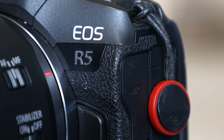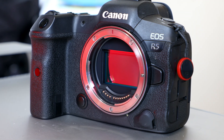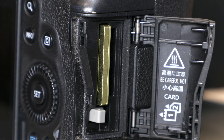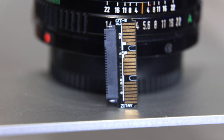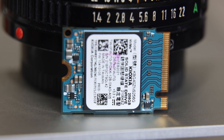For testing I'm using a Canon R5, which is capable of generating about 20 gigabytes per minute of data — a massive amount, which is why card standards like CFexpress Type B had to be developed to handle that video data quickly while meeting thermal and power requirements. Internally, CFexpress cards are just PCIe devices within NVMe — pretty much the same as an internal M.2 drive.